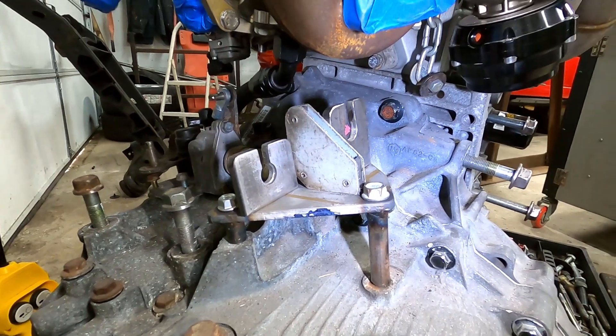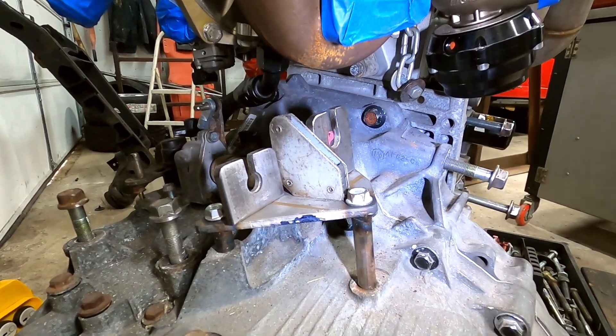For heat management you really want an air gap and a heat barrier. The cables will be lowered and heat-sleeved, but I'm also going to go see Clyde at Fab Tech and on a sheet metal brake we'll make a thin aluminum or sheet metal heat shield — basically an L-shape — that'll do wonders blocking radiant heat and make your shifter cables last a lot longer. Top tip there. Once I get these squared up and tack welded, I'll sand blast it, prime it, paint it, and get CAD files done so I can offer the shifter bracket.